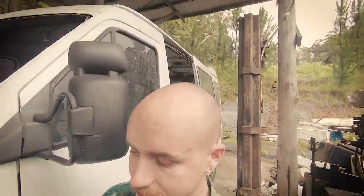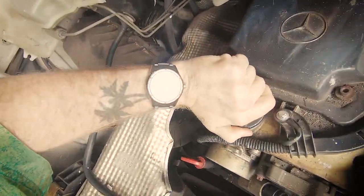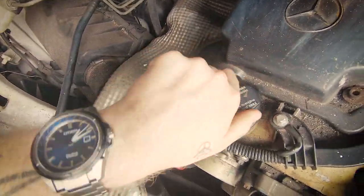I digress. Bad points, we're trying to pick out the bad points. Here's a bloody good one for you, check this out. Inside of here, if I can get her undone, is moisture. Now, I'm still not sure if the head gasket is bugging, or the fact that it was sitting without injectors in it for a little bit too long in the rain and all the cylinders filled with water. Just doesn't really explain the moisture in the oil.